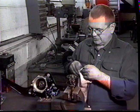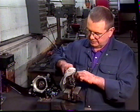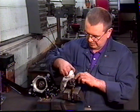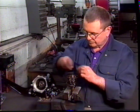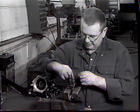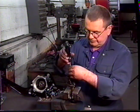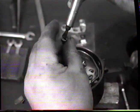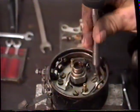You also need to take the opportunity to wipe the grease off the point that is put there to protect it, otherwise it won't make a contact. Fit your screws into the base plate and just nip them up gently. A magnetic screwdriver helps. Use one hand. That's good.